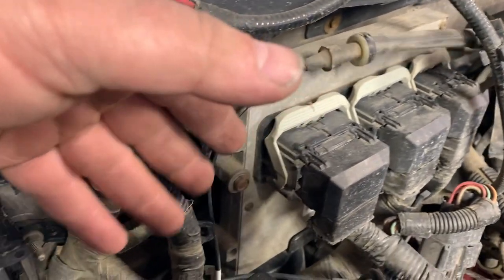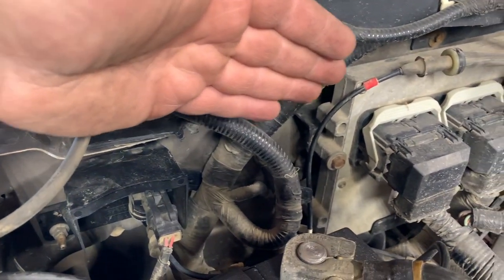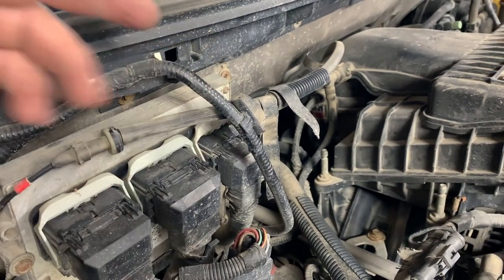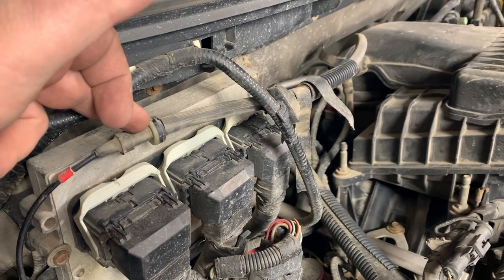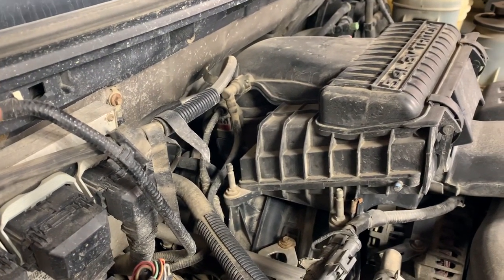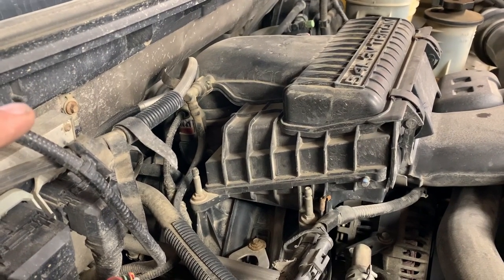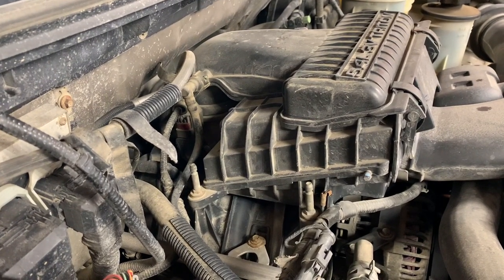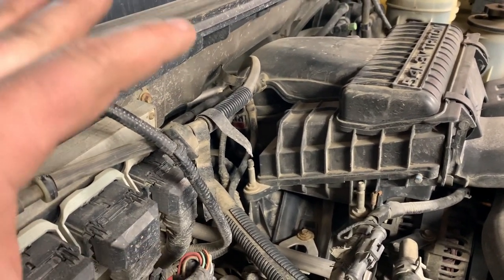You can inspect the line at the solenoid itself, or you could pull it off the solenoid itself, because basically, if we don't have at least 10 inches of vacuum in here, we're going to have issues. So I want to check it at the check valve, to make sure that the check valve is working. If we don't have at least 10 inches of vacuum, that means either this line is damaged, and in that case, we would probably have a check engine code saying that the fuel trims are out and the engine's running lean and is dumping more fuel in, or the engine's in bad health.